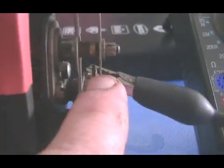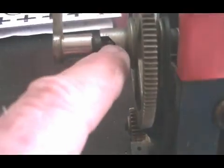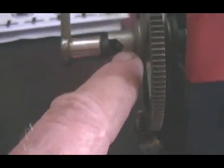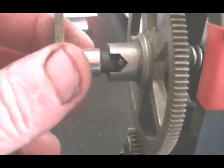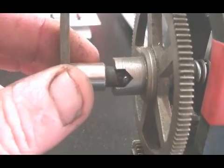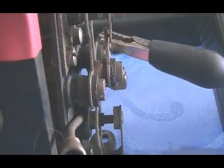On the front here you can see there are two sets of points that I was talking about, Cultus. On the back of the crank handle you can see we have an angled cutout in the crank, so when you turn the crank it slides down that cutout, and on the other end this opens one set of points and closes the other.